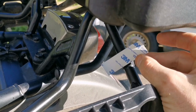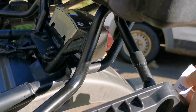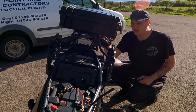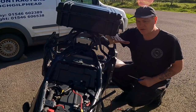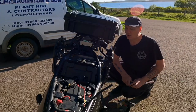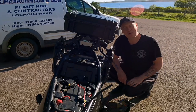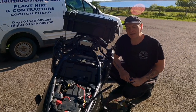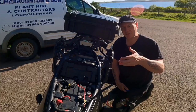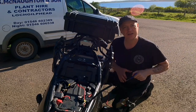In the box you also get a little bit of 3M sticky tape, so I'll put that on there just to give it a little extra grip. I've put a little bit of blue Loctite on the screws here to stop them from rattling loose, especially at the back of the bike. Now at this stage, you're probably wondering why I've taken the tank off — it's because I've got a little switched relay system already installed, and the connectors for that are underneath the tank.